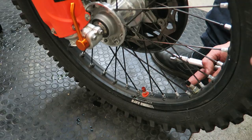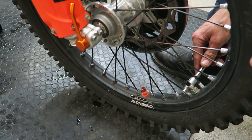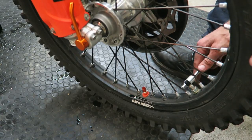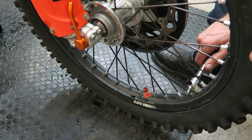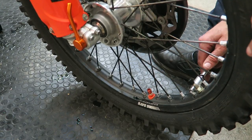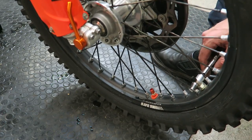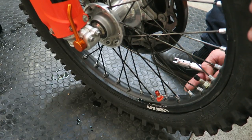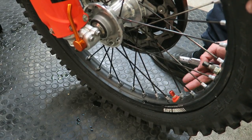You should start at an easy-to-remember reference point — I'm going to use this valve as my reference — and start adjusting this spoke. Make sure your torque wrench is in the correct orientation and start torquing. That spoke is already at torque so it's not moving. If it was loose I would recommend you tighten it a maximum of half a turn, then skip two spokes — tighten one, skip two, and tighten the next one.